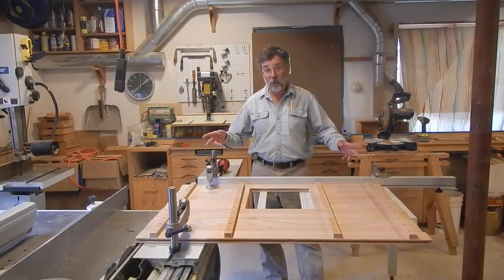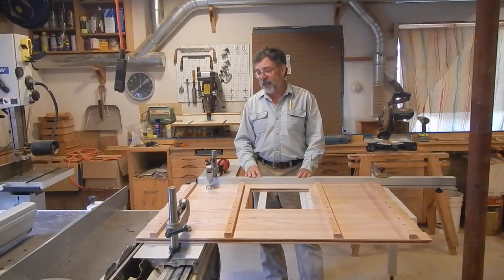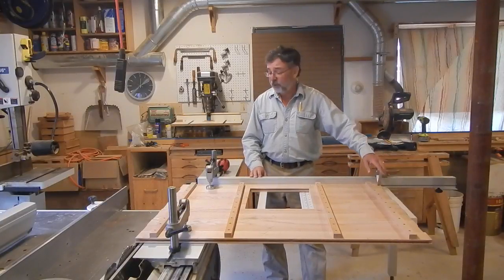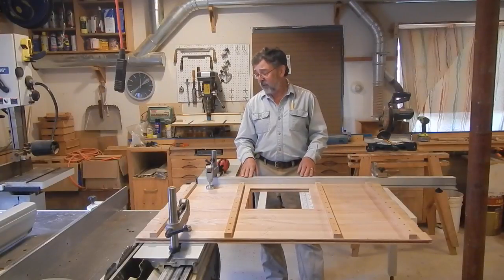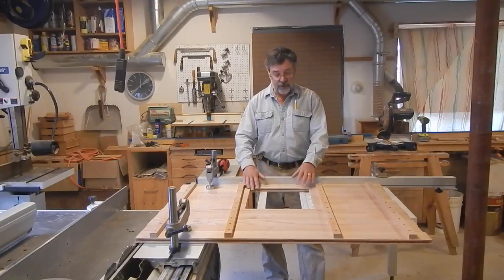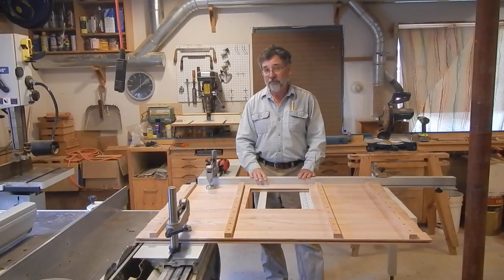One of the last things we have to do before we take this panel out to the boat is to cut it to width. As I mentioned way back, the piece of plywood flooring that I took out was 43 inches wide, and I went out and measured again to confirm that, and then I cut a test piece using this stop and took that out to the boat to triple check and make sure that 43 inches is the appropriate dimension. So we're going to first trim one side and then the other, and I established the lines for the cuts by measuring out from the center. So the access panel will remain centered and the cleats will remain in the correct positions to avoid the stringers. I hope.